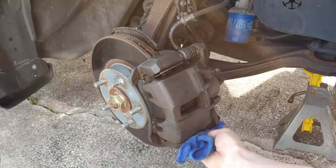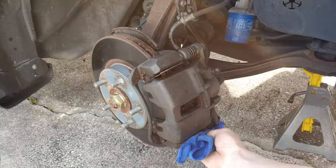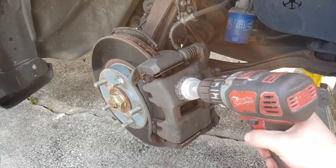After we got the wheel cleaner off the brake caliper, the next job is to get as much rust as we can off. This one's not too bad. You can use sandpaper like I said earlier, but the wire brush drill attachment is going to make a lot more quick work of it, so let's get started.